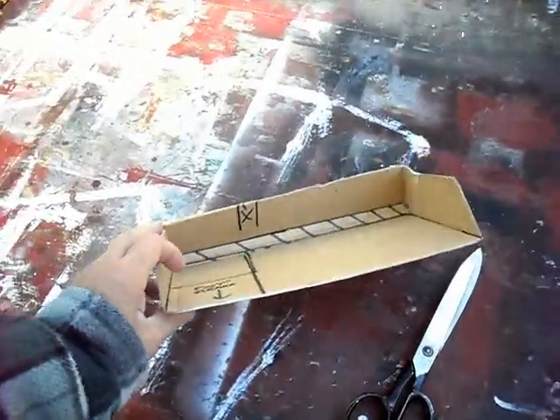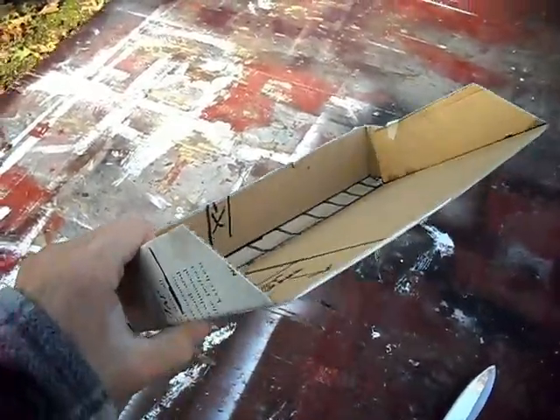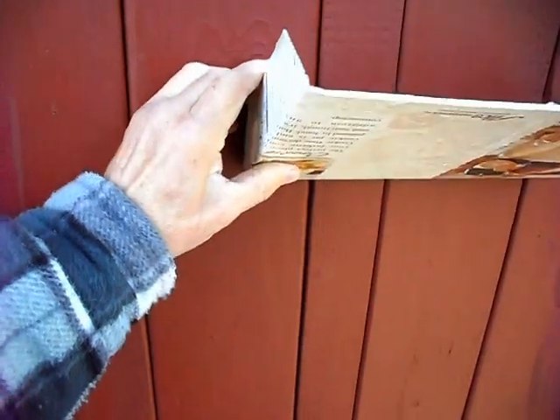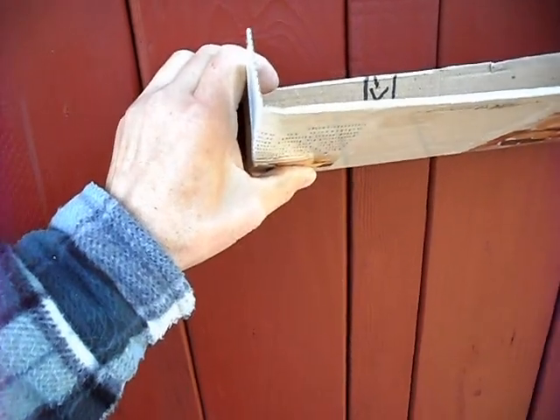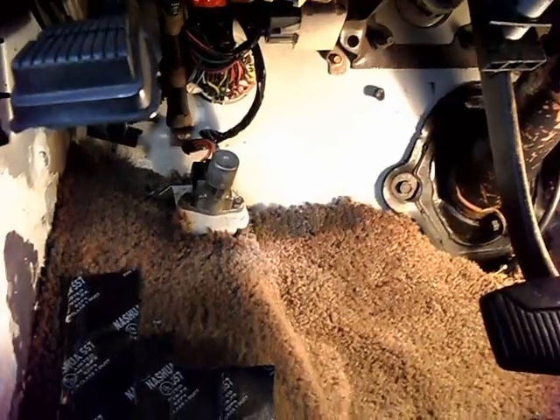There's just no way to stop it. So what I'm going to do — and if any of you out there have a similar problem with a vehicle leak — this is the way you may have to do it. I've done a lot of thinking and come up with a system. I'm going to get this out of cardboard first. I'll show you on the side of the shed here. Pretend this is the firewall on the inside. I made this at an angle so it will sit like this, and any water that drips down from underneath the dashboard will be caught on this thing, and then there'll be a drain hole made in the bottom with a little rubber hose going outside the firewall.